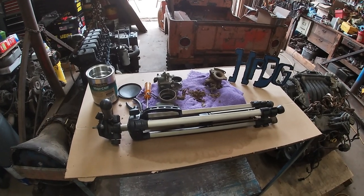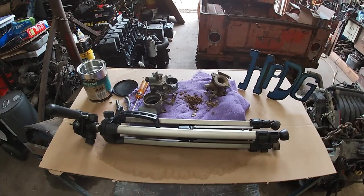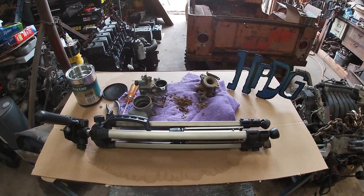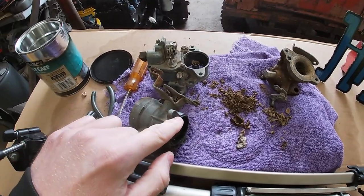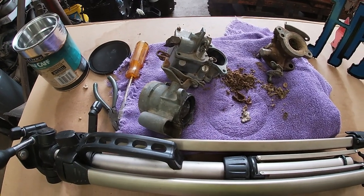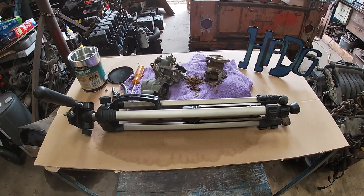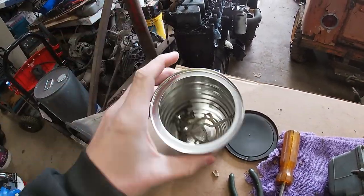A little bit of an update at the end of this video. Got the carburetor apart. I was guessing the carburetor kit was going to be relatively inexpensive. I've bought a lot of carburetor kits for older carburetors before, and the only places that had these kits were O'Reilly Auto Parts and KaiserWillys.com. Now the O'Reilly one was $47 and it had two gaskets — the gasket between these two pieces and the gasket for the top of the fuel bowl. No other gaskets, and I thought that was pretty ridiculous. It didn't even have a bottom gasket for where it goes on the manifold. But KaiserWillys had the entire kit — all I actually need is the shell of my carburetor. They give me all the gaskets I need and even provide the rods that move up and down for the carburetor.